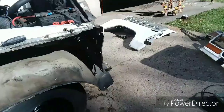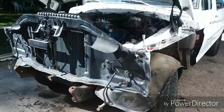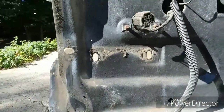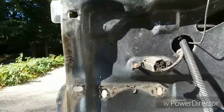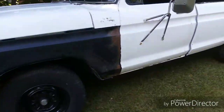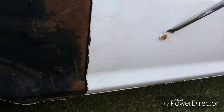Alright, it's a new morning. I've got it about ripped down as far as we're going to take it today on this project. Since this is a '79, it had the headlights up high, and I'm putting the older style grille in it so they'll be down lower — I'm getting ready to drill the holes in the radiator support. So we got the new fenders on. This truck had been in an accident before, we learned, and it pushed back the driver's side, making this fender gap pretty tight. I had it really good earlier and then drove it literally a few feet and it shifted back, so now the door wants to hit right there in that corner.